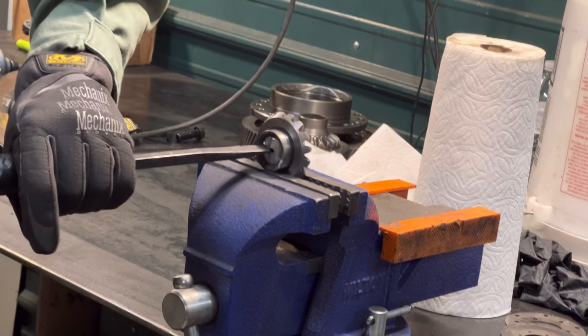So it was a bit of a complex problem. Not only was the end of the axle mushroomed out slightly so it couldn't fit through the hole, it was also peened over about one degree so that the splines no longer lined up — and it also pinched the clip inside its groove. That's a pretty interesting problem, but I'm glad I did this teardown because I learned that you should be careful with a collision vehicle, since you don't know what kind of internal damage you'll have until you tear it apart. If you want to see my two favorite ways of removing an axle from a transmission that isn't damaged, click over here to see how it's done the easy way.